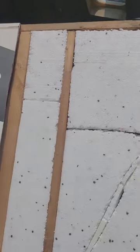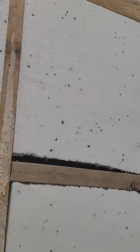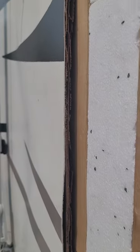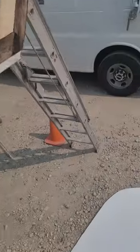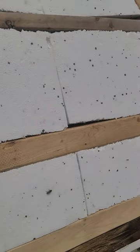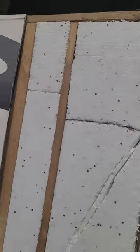So that your new fiberglass panel will lay completely flat — the original one has a 1/8 mahogany board normally on it to give it strength. Now we are putting down just a fiberglass finished piece that goes on top, so we need the foam insulation to give it that backbone. When you put the adhesive on, it has something to stick to and be a solid surface.